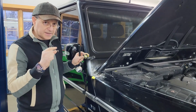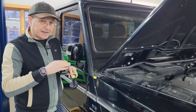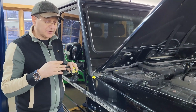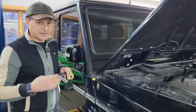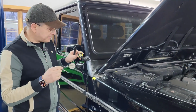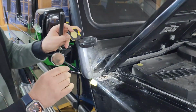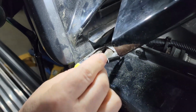which is bare metal to bare metal, overlapped, and it will give us a very solid joint. Such a solid joint that manufacturers use that type of joint for installing quarter panels on brand new vehicles. So we are going to use that here. It's a two-component metal-to-metal bonding agent. To gain more of the surface, we're going to grind a little bit more.